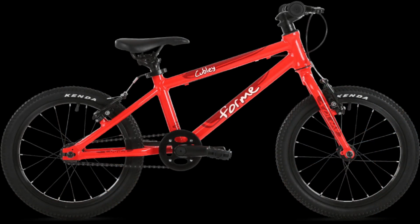Now, here's a kid's bike, and you can see the front fork is straight. Doesn't look like it would matter much which way you put this fork on, but look at how the handbrake grabs the wheel. That should always be on the outside of the fork, not on the inside. There are so many different designs. It's possible it could work fine forever, but it's also possible that something could get jammed up. The cable for that brake could bind.